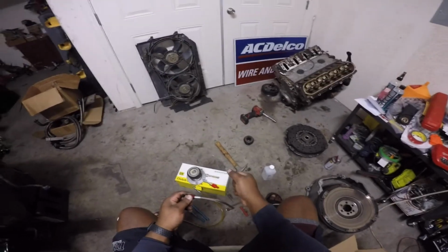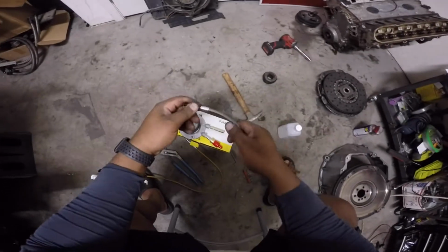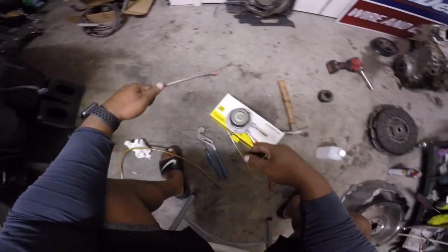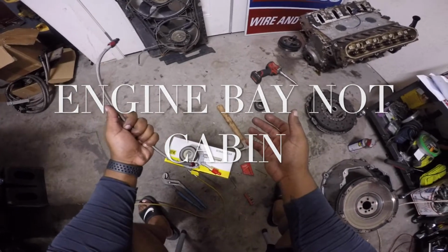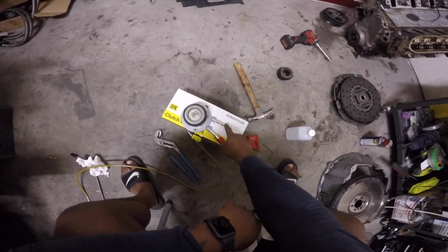Crack it open, have somebody hit the clutch, close it, instead of it being way up in the transmission. So these two lines, I suggest you do. Usually I make this line longer up in the cabin, but I still have to have somebody bleed it for me, so I just use a shorter line instead of having an eyesore in the cabin. So you can just unthread this one out.